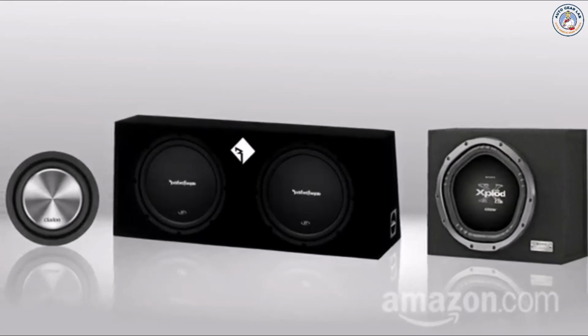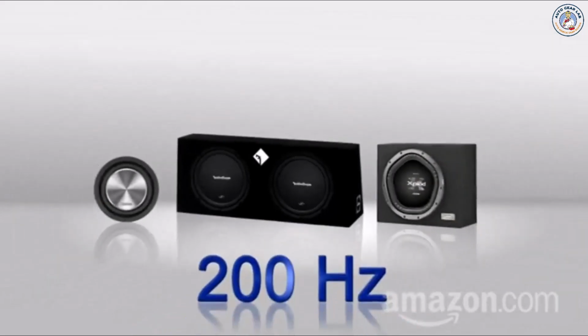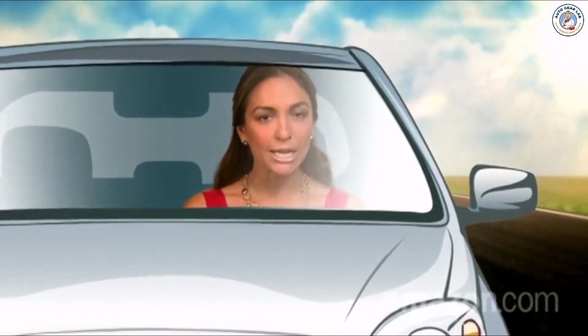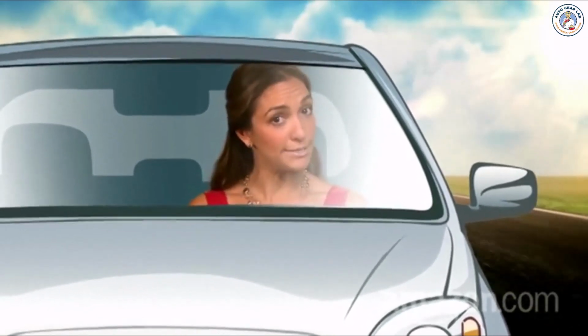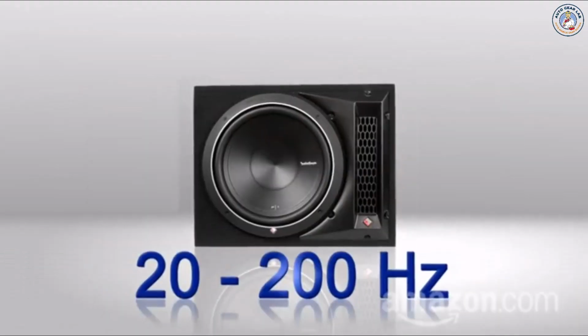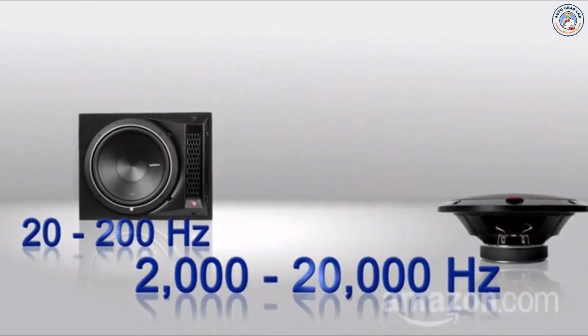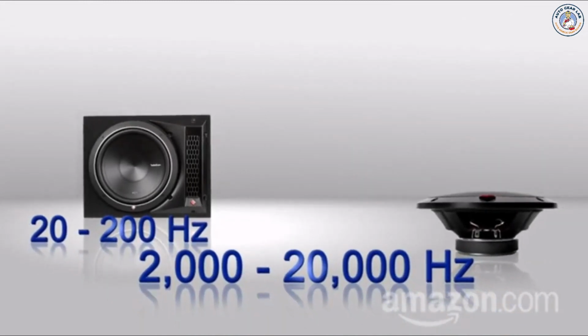You don't just want to hear music through your car stereo. You want to feel it, man. So consider a subwoofer, a dedicated speaker that handles frequencies below 200 hertz, meaning fewer than 200 sound waves per second. The bass. But subwoofers are not just for shaking the windows and vibrating your spleen, although in certain circumstances, that would be nice. Fact is, good subwoofers can help your car stereo with high frequency sound too. How? Subwoofers play the low frequencies so the car's smaller speakers don't have to. Result? The little tweeters can focus on their specialty, the upper register.